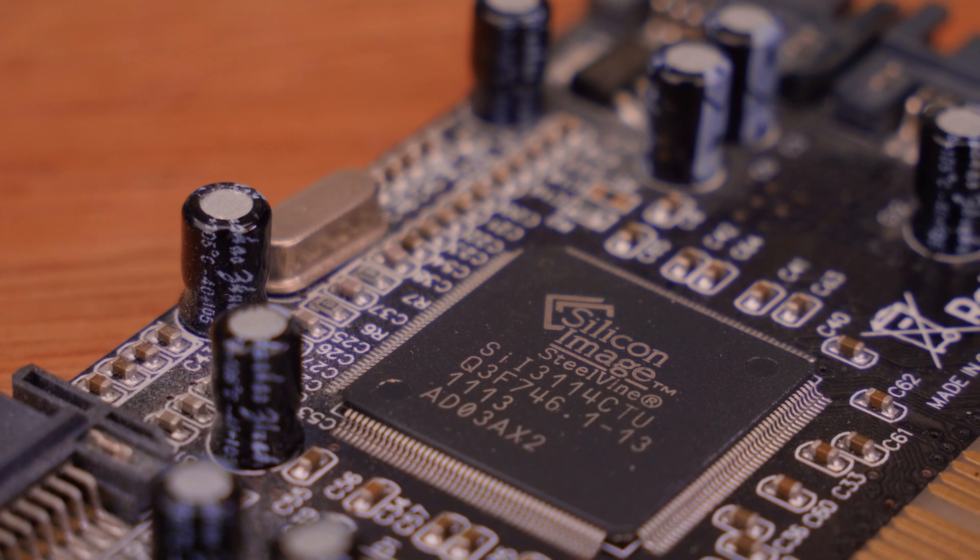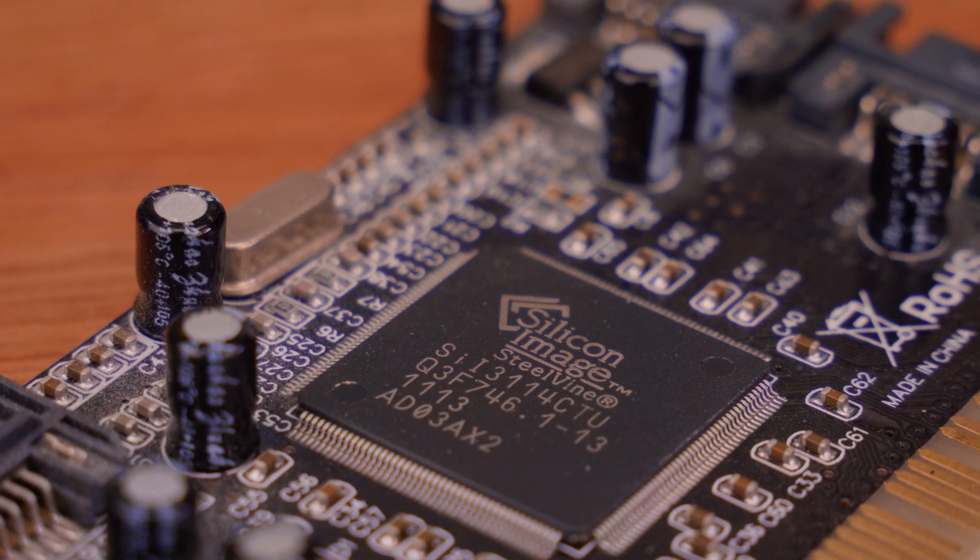In a recent project I'm putting together — hasn't come out as a video yet — I'm building a roughly 90-terabyte server. I saved two grand by buying cheap PCI Express 1x cards to connect all the drives, because I'm not expecting super high performance in reads and writes. I just want to load stuff up as archives.